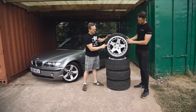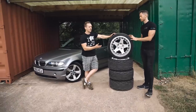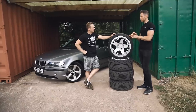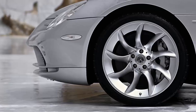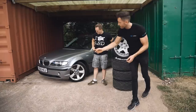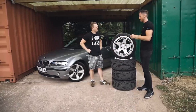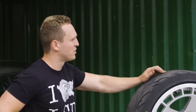Talk to me quickly about wheel design. Are some wheels better at cooling brakes or taking air away from brakes? There are a couple of wheel designs that have been used in the past — the E34 M5 had turbine wheels, which at the time no one liked, but I think they look super cool. The SLR had turbine wheels as well. But it's not really a big effect. If you want to cool your brakes, you generally punch out a hole in the front of the car, put some ducting into a wheel arch so it blows onto the brake disc, and then that'll exhaust the air out the side.